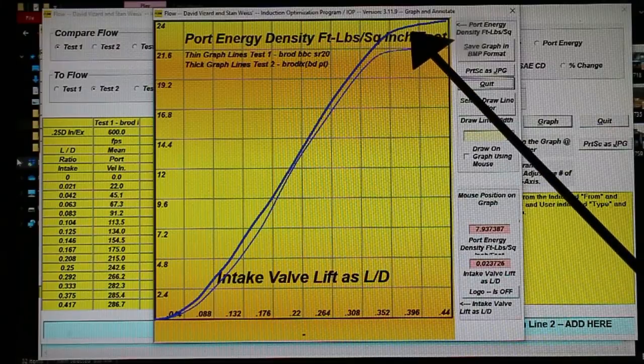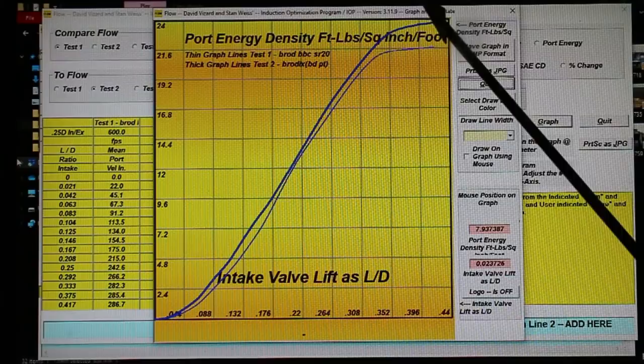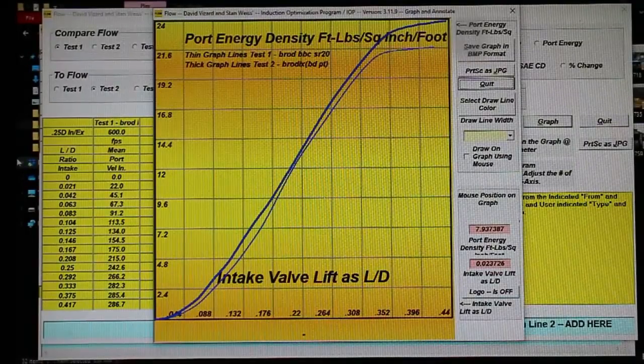Well, we are not quite as good as the SR20 in terms of horsepower with this head, but ours can get better. Now, the thing is how much less are we? We're about 20 horsepower down compared with a regular good 24 degree head being pretty close to 100 horsepower down. So we've made a big improvement in our cylinder head. Oh, by the way, we'll match the SR20 foot-pounds most of the time and often beat it. So there's a point in our favor.